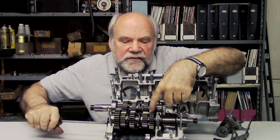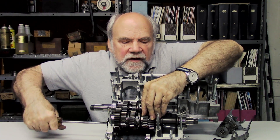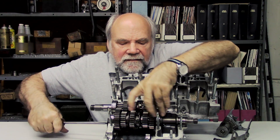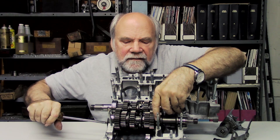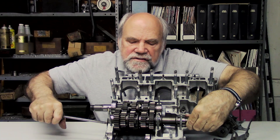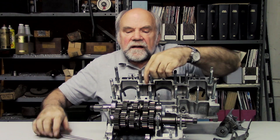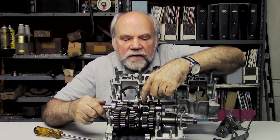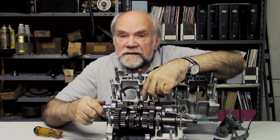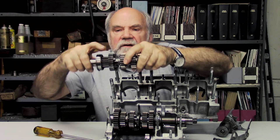There's first. Next it will shift to second. There it shifts into second. We can't just run the gears through all five speeds, because if two of the dogs don't fit — one dog into one slot, but instead one dog hits the other — it can't engage. And we can see that right here.